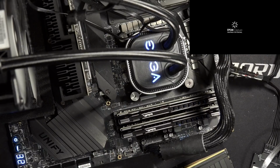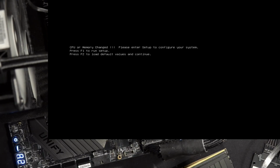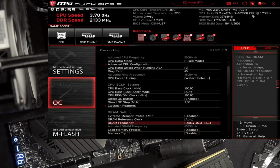So anyway, now we're in dual rank with 4 single rank memory sticks, because the CPU has 2 memory channels. Each memory channel is the person actually getting the boxes of apples, if we go back to my apples in boxes analogy. And this should still run 4400. I'm not sure if it'll do 4533. I really doubt it. But I've not tested the 4 memory stick setup at all. And also there is, of course, quad rank, when you take 2 dual rank sticks and shove them into 1 channel together as well.